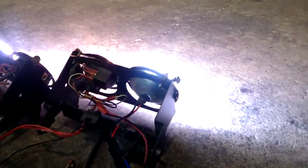Can't really tell a difference on camera, but you can see them — those are pretty bright. They're 55 watt apiece. The HIDs are actually the 35 watt HID, and the 55 watt halogen for the highs. But you could run HIDs in the highs too if you really wanted to — just buy another HID kit and wire it in, and then you have all four HID, which would be a cool upgrade.